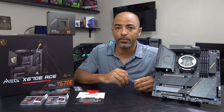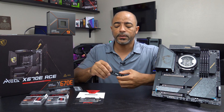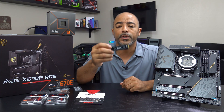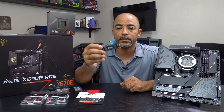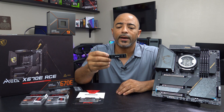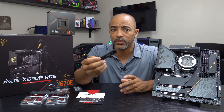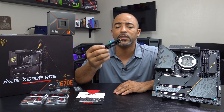I have a lot of motherboards, and this is my first time seeing this. So this in particular is the PCIe Gen 4.0 Fury Renegade by Kingston, and I absolutely love it. It gets like 7,300 megs per second read speeds. I put these in RAID 0 hitting like 13,000 megs per second read speeds — pretty crazy. They stay cool.